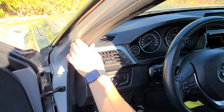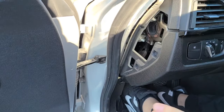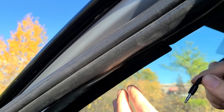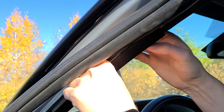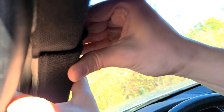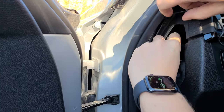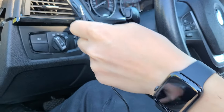We'll show you how to wire the microphone to the driver's side A-pillar for better Siri performance. On the driver's side, pull down the weather stripping, then use the panel removal tool to remove the panel and unclip the A-pillar. Take the microphone and feed it behind the airbag, pull it all the way through. Once it's through, clip the A-pillar back and choose the position — we'll place it closer to the windshield. Hide the wire under the weather stripping, drop the connection behind, and pull it through. Now we have to get this wire to the back of the stereo and behind the glove box.